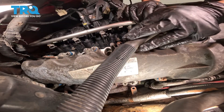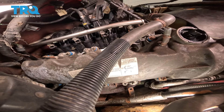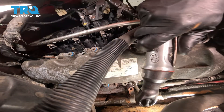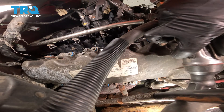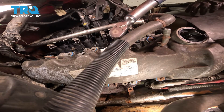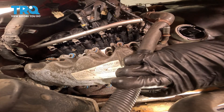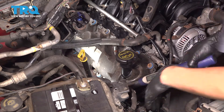There's also a bolt all the way in the back — don't forget about that one. I'm going to leave the dipstick tube disconnected for now just because I want more access in here; it'll make things a little bit easier. Starting in the center, just bottom these out and get them snug — I'm not torquing them yet. The torque is 89 inch-pounds, so it's very low, so when you snug them up, don't go too tight. Once all of them are in, let's torque them down — 89 inch-pounds, starting in the center and working towards the outer bolts. That one in the back I can't torque, but I'm going to get at it with a ratchet and do my best to tighten it.